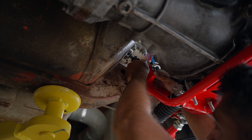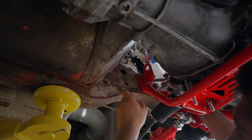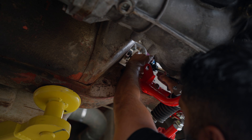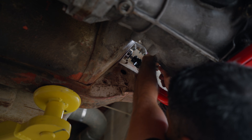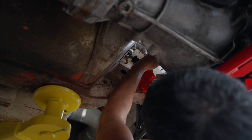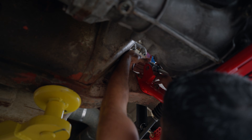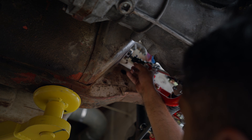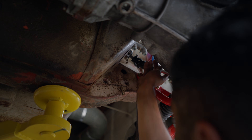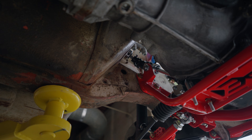Next is the rod end that supports the shaft. What I like to do is completely disassemble that shaft collar — disassemble the rod end and carefully sneak in the double D shaft. You might have to loosen the set screw on the first u-joint. Once you have that put in, reinstall the rod end. Now you'll notice the shaft still has to be tightened — it slides between both of them, so split the difference. We do give a little extra length, but make sure you have ample engagement on both sides.